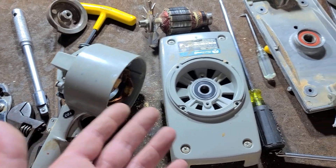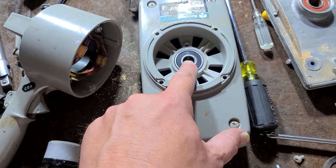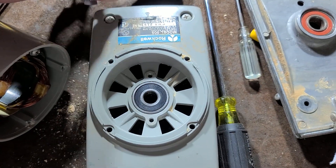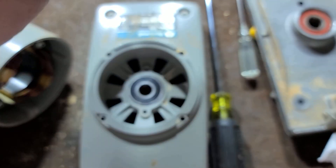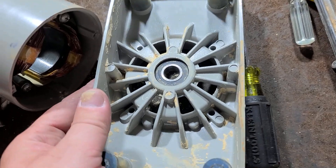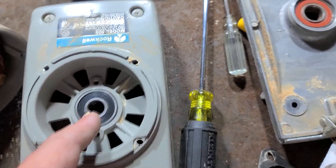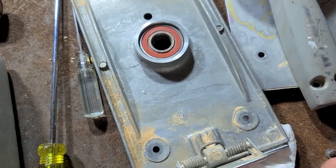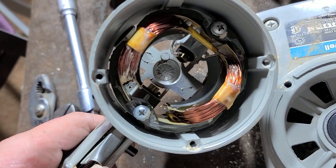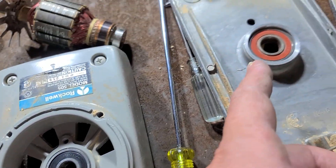I'm jumping around here to try to make this as quick as possible. The motor is actually pretty tightly pressed — not super tightly, but it is pressed into this bearing. And if you don't have a press or a puller that you can get in there, just put a socket — 5/16 socket — over the top of it over the end when it's sitting like this. Find some way to evenly support it and then tap it out. Once you do that, there is a special retaining plate. You can pull that off and wipe that down. There's a snap ring on top of this bearing — wipe that down. Make sure you wipe down this bearing and blow out that bore. And then you can do the poor man's version of just popping out the seals like with a little needle or a pick. It might bend them a little bit — you might have to bend them straight. It gets you a little bit more life until you order bearings.